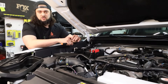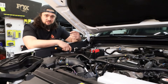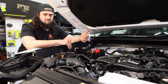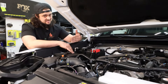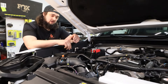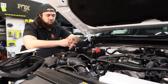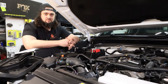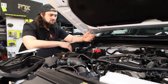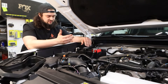There are two real reasons that you want these terminals. One is obviously the connection points — the factory terminals have one stud coming out the top, they're stamped terminals, they're not that strong. The second reason is reliability. Those factory terminals, when you start stacking a bunch of stuff on there, have a tendency to crack and break, essentially creating a bad connection situation. You never want poor connections with electrical systems — you can break down, you can have fires, computer issues. When you use your winch it won't connect, it'll overheat because it's poor contact.